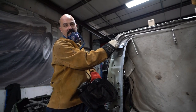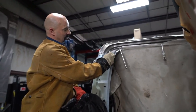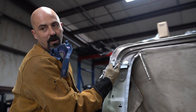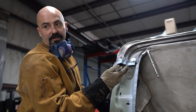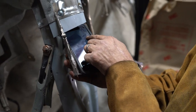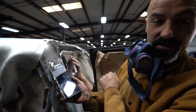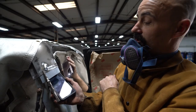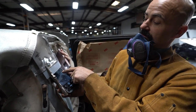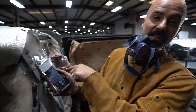Got almost a perfect heat ring around it. Look at that ring. Almost a perfect heat ring around it. There's not a big bubble sticking out the front side. If you actually look at the back side of this weld, the back side of it will look like the front side of the weld. And that's what you're going for. And when you look at it, it actually looks like a plug weld from the front side. And when you get a truly good quality secure weld, true penetration is that right there. The front and the back of the weld looks the same.